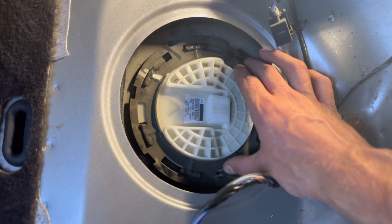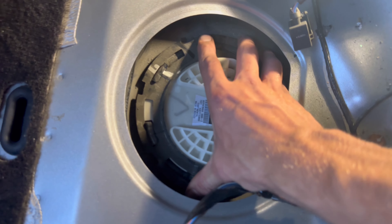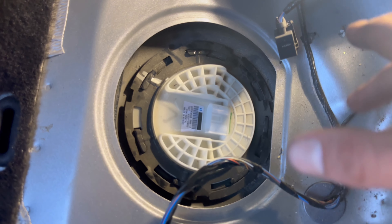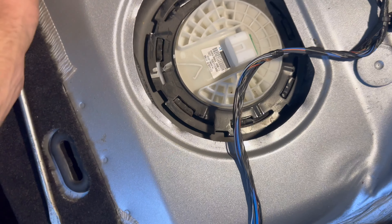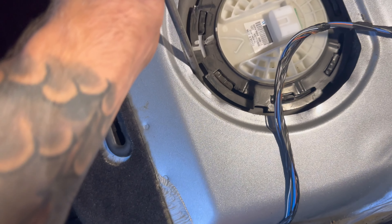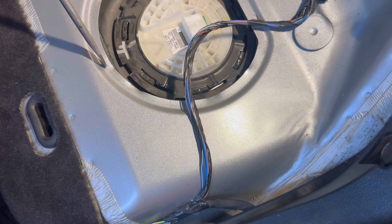Now as you can see there's a little casing around the fuel pump. There's a special tool you can get or rent for this, or you can use a flathead screwdriver and a rubber mallet — that's probably what I'm going to do, just knock it away from these teeth a little bit. Let me see how I can maneuver it first before I set the tripod back up.